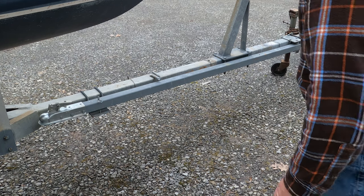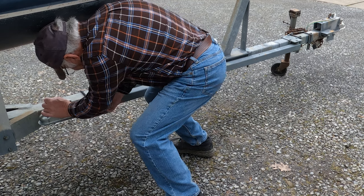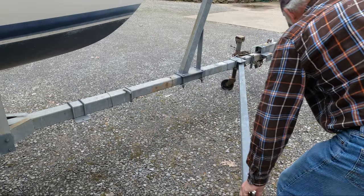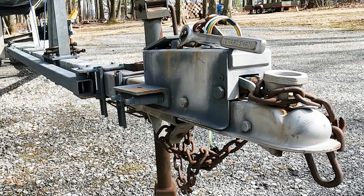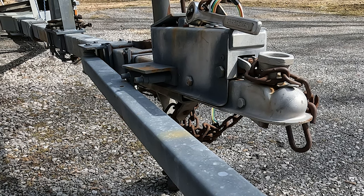I said in video number 4 that I changed vehicles, which is much lower in ground and water clearance, to tow the boat, so I had to extend the hitch for launching and recovery. I had no problems with finding the metal and using tools in my garage. I cut the metal to size and drilled holes in everything to bolt it to the trailer.